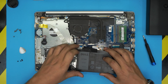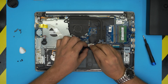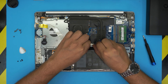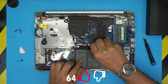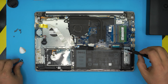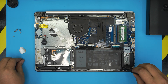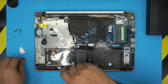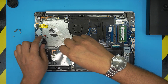Once you get the new battery, set it inside — align it or place it with a slight offset, it doesn't matter. Put the jack connector straight in — don't go sideways — and push it toward the jack to make sure it goes all the way in nicely. Once the battery is in, grab the four screws you removed and screw them down firmly — not overly tight, just securely in place.